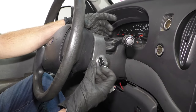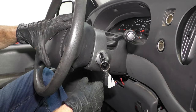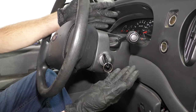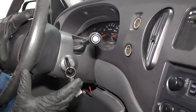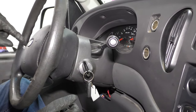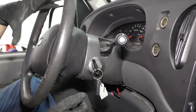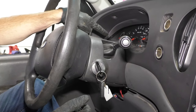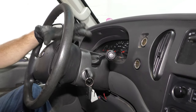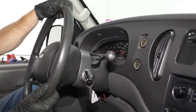Fixes for this are a little bit difficult. You're going to want to follow your service procedure. One thing you definitely want to make sure you do is always disconnect your battery — you have an airbag located right inside your steering wheel and you definitely don't want to damage that. I'd also recommend tying off your steering wheel so there's no way it can spin around. You have an airbag, so there's a clock spring located back there. If the steering wheel spins around once you take off your steering shaft, you're going to find that you have an airbag issue and more than likely a light on your dash. This is a safety issue, so follow your service procedure to the letter.